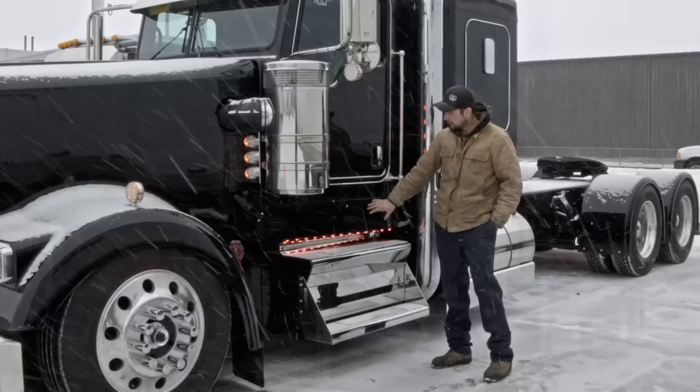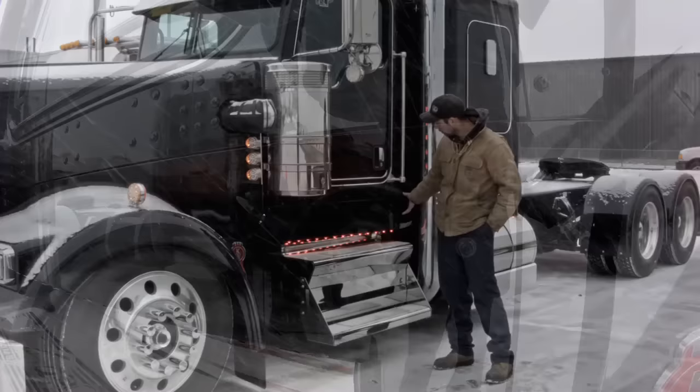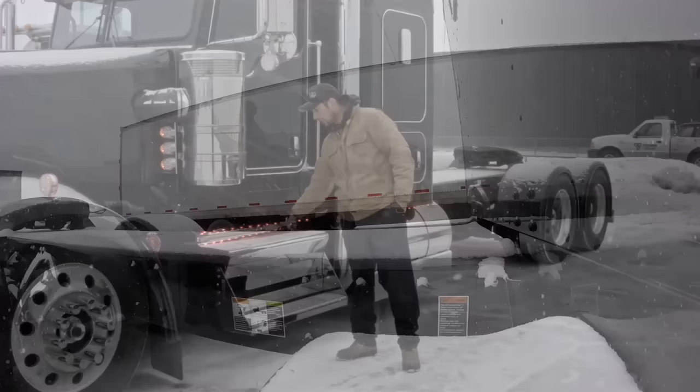We went ahead and painted the cab panels and the bunk panels. What we've done is knocked all of the original mounting hardware off of the cab — on a Kenworth, they always have screws that go through the front face. So we've put a bracket on here and mounted them up through the body, giving it a very flush, very clean look. We've also got red three-quarter round lights facing down on the cabin bunk panels to shine down at night, which gives it a pretty cool effect.